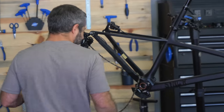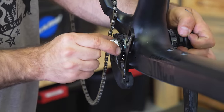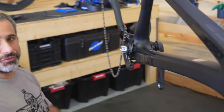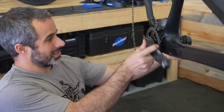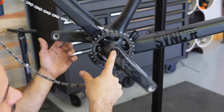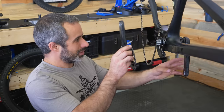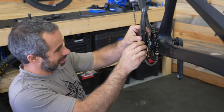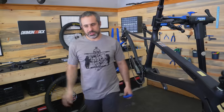We're just going to put this all together now. Dust cap goes on first, then a couple of little spacers. Something funny about these splines — you can actually line up the crank arms the wrong way, so you can have a crank set that's completely not right, and when you get on the bike you go, what is going on? With this one it's pretty hard to mess up — they're nice, big, chunky splines so you can line it up pretty easy.